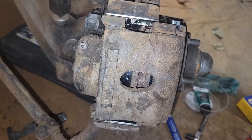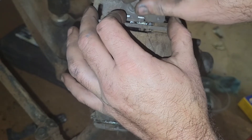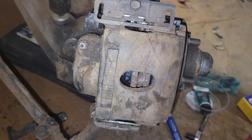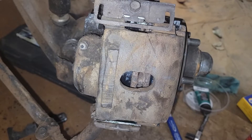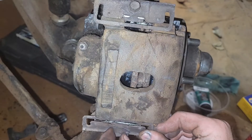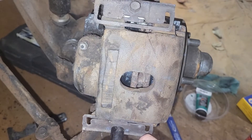Now we can reinstall our brake hold-down spring. I'm not going to put never-seize on that bolt — that's a bolt I do not want backing off. I usually service my brakes quite a bit; I'm a firm believer of keeping my brakes cleaned up on the sliders, slide pins, and brake pads. I do it every three months because I don't drive my vehicles a lot, they're parked a lot, and around here there's a lot of moisture and salt on the roads in the wintertime.